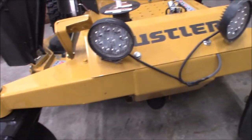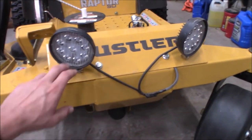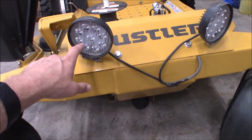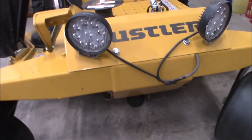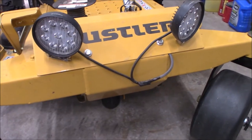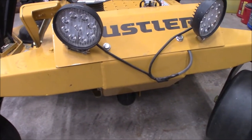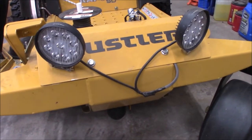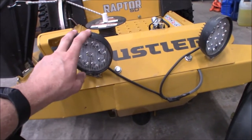These are two Amazon special LEDs. You can get an official light kit for this thing for a few hundred bucks, but these are like $15 a pair, maybe $20. Watch your amperage output — they'll be rated in watts, divide by 12 to get amps. This Kawasaki is probably a 10 to 15 amp output, and remember we have an electric clutch to account for, so we don't want real high power draw up here.